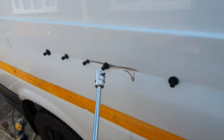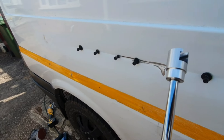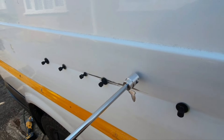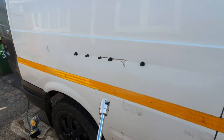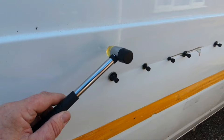Back in the 80s when I was a panel beater, what we used to do with dents like this is drill a one-eighth drill into it and use a puller that had a screwed thread - like a self-tapping screw thread - that we used to screw in and then pull it out, and then just weld up the hole afterwards or fill it with a bit of brass. If I had these back in the 80s I'd have been sorted.